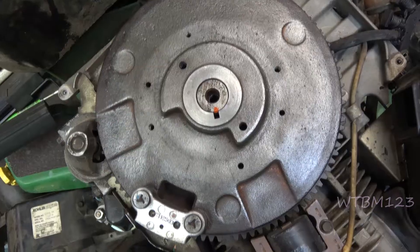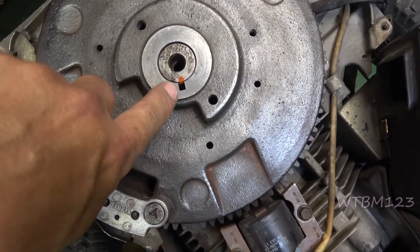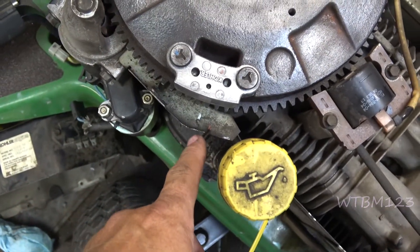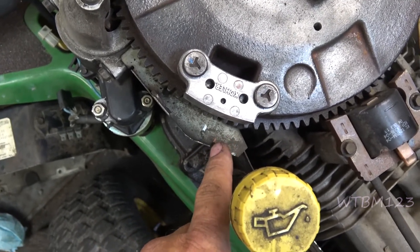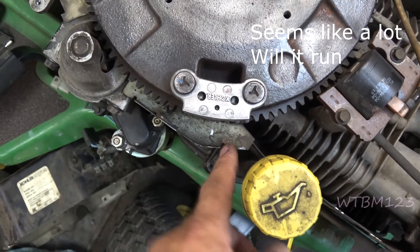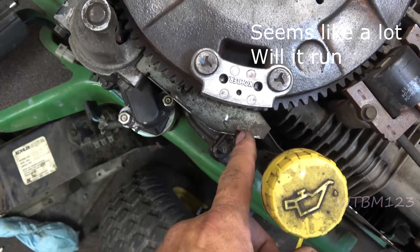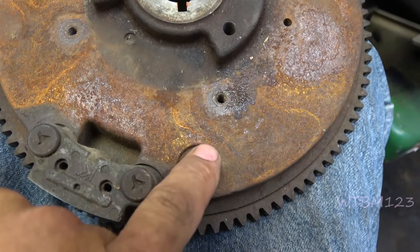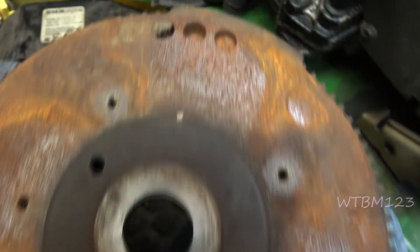The keyway is still lined up with the crank. Down here you can see this little silverish mark — that's where the other one lined up. So that's telling me the center of this new flywheel lines up here, while the center of my old one lined up over there.